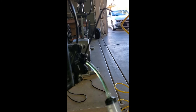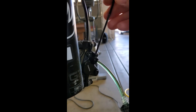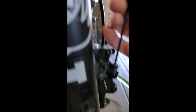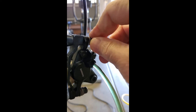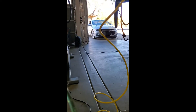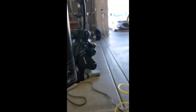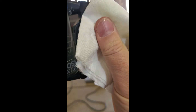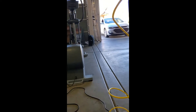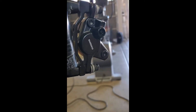Our system is now filled. Take your 3mm hex, put it in the caliper port, and screw it down — tighten it pretty good, not over tight. Now it's closed and no air can get into the system. Take the syringe off. You might see a little bit of extra fluid — not a big deal. Take a rag, clean that up, and replace the little rubber stopper grommet.